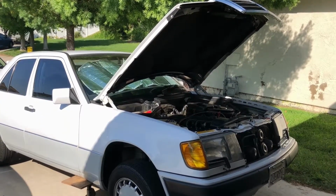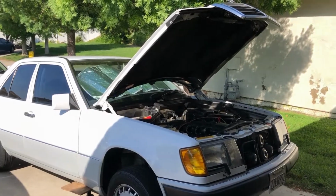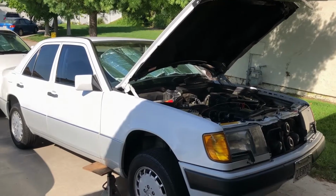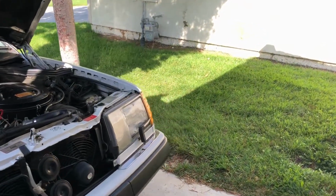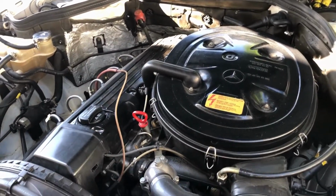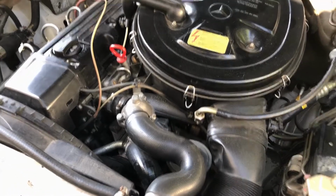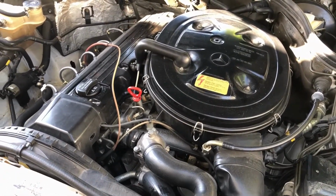Like I said before, I'm not going to do an acid wash. I don't want to weaken any freeze plugs, original. I don't want it messing with a heater core, which is a pain in the butt to replace. So just put a new radiator, new thermostat, new fan clutch. Water pump was replaced a couple years back. If it was a weak water pump, you would hear it. And the reason I replaced it last time, it wasn't leaking. It was just real noisy. And so I think it was just the front bearing. But when you hear that, you might as well replace it. And that was almost like a 5-hour job because there's one bolt you can't get to.